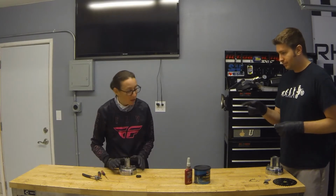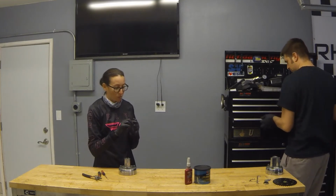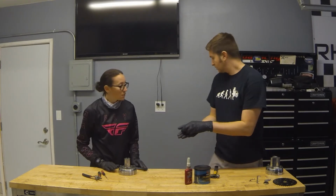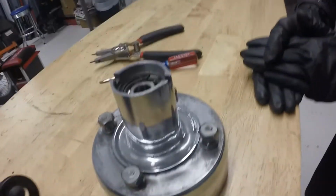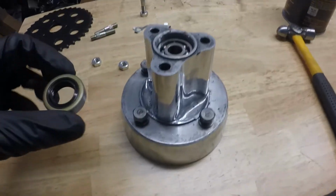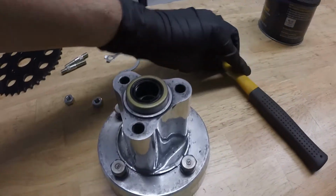Up next, that's the seal. The seal's got two different sides to it. One smooth and then the ridged side. Yep. Ridged side goes out. Seal installation. We have this area with the dish, and we can see a little spring inside there. It's very tiny in there. We see that little spring wraps around. That goes to the inside, so this will get assembled just like that. On the rear, we've got this metal walled seal that we're going to place on, tap in with our hammer.